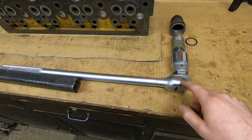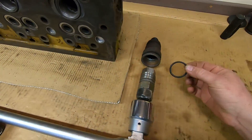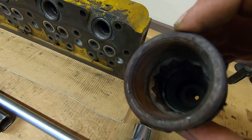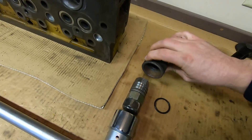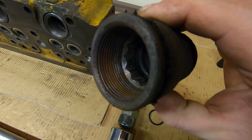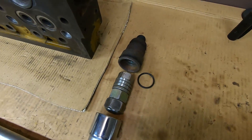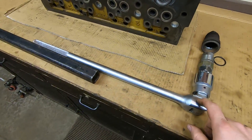For what I use to pull on those pre-combustion chamber tools: a big 1-inch drive breaker bar with a few feet of cheater pipe. Another tip — I usually use a little O-ring to interface between the end of the tool and the inside of the chamber. I'll find an O-ring that fits down just below that hex contour and sits on top of that tapered injector seat down towards the bottom, because the leading edge of the tool can get down past that hex and actually scar that tapered injector seat and cause you all kinds of grief. An O-ring dropped in there is a perfect little blocker between the leading edge of the tool and that injector seat, saving you grief trying to remove burrs when you're pulling on this for all you're worth.